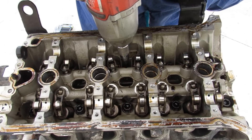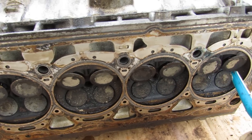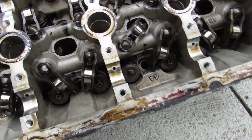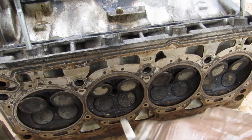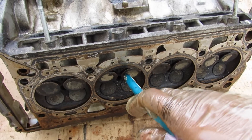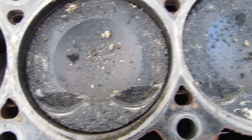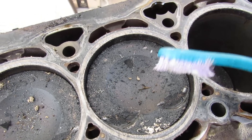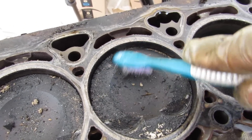I'll zip off the head bolts with a T50 and lift off the head. And there's a problem — I can see bent valves on all four cylinders. With the camshafts removed the valve springs should be pushing the valves closed, but they're still open, which means they're bent. If this head could be salvaged it would definitely need to be remanufactured. On all four pistons you can also see evidence of valve-to-piston collision, and there's a lot of carbon build-up.